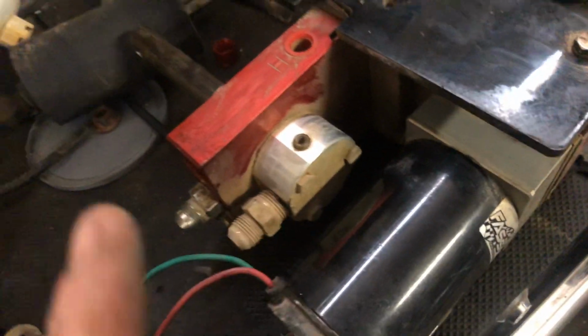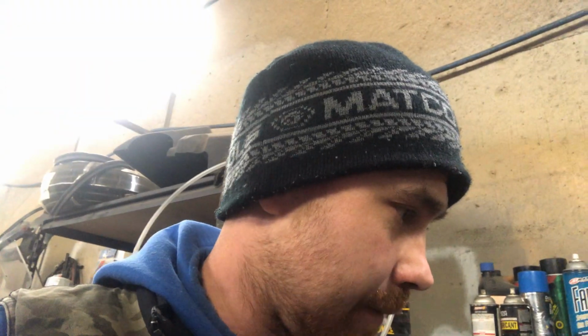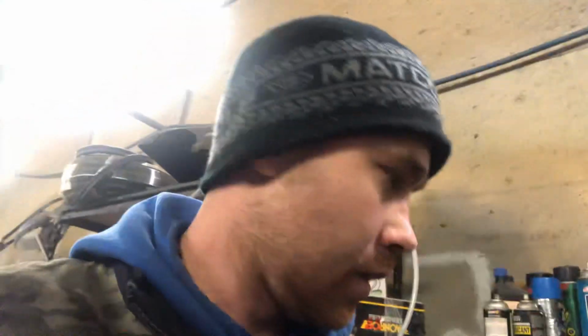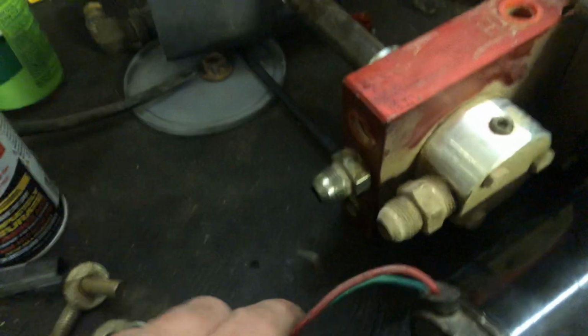But here's the trick on it. This pump came off a pulling truck. What does a pulling truck do? They go on a track 300 feet down the road, and they shut it off, and that's it. I don't think it has that many miles on it. One thing I found out is this thing lasts a long time, so it should work. If the guy wants, there's a port up here where you can run coolant through it to heat the fuel, but I don't need that. I don't live in that cold of an environment.